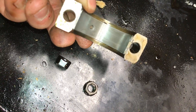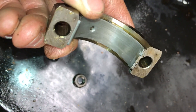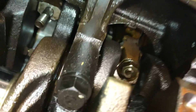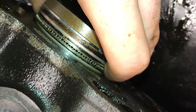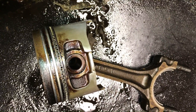So this is the cap and those are the two relevant nuts. That is the bearing — actually for the mileage it looks pretty decent, you can't see any copper showing. If you look down in there, there's the other half of the bearing on the connecting rod. It's already pushed through the block so you can just slide it out. There we go — one piston, three more to go.